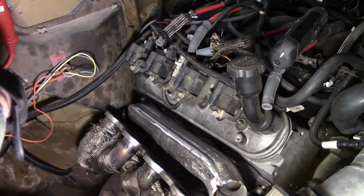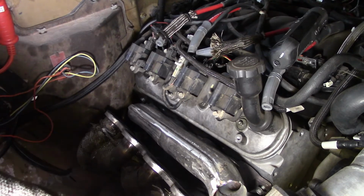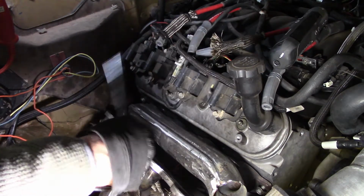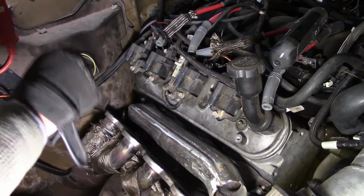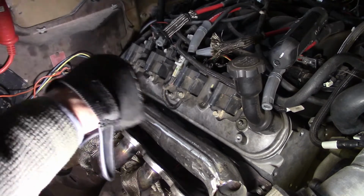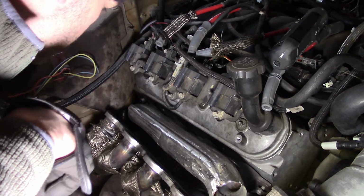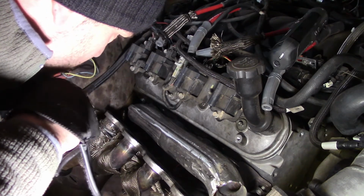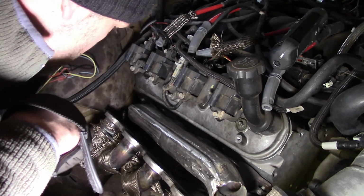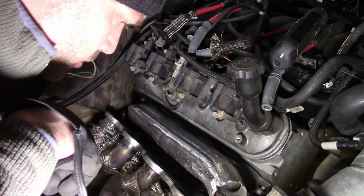So the wastegate's gonna go, that's been the biggest thing I've been thinking about. I want them accessible, so I may put this one right at the bend here because this won't be there. I may put this one right here and then bring this wastegate under the turbo if it needs to be in the 90 flow. So it may have to go underneath the pickup because on the divided, you got to have two wastegates, and I've got a 240. I've got a 144 already, but probably gonna have to get another one. So it may get to go underneath in the bend underneath. I just want it easy and accessible. It would be nice if you ever have to change springs or make any changes.